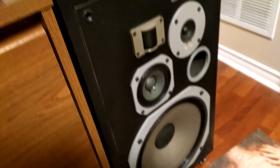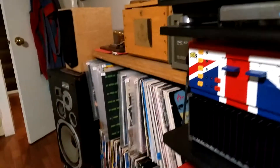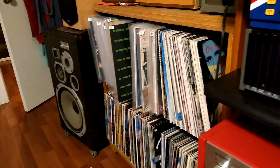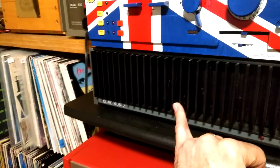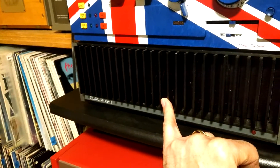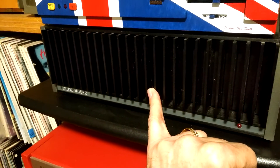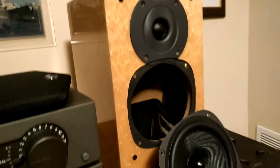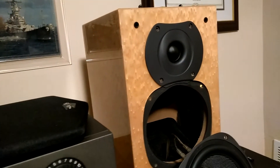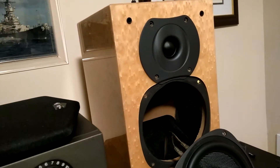What I should have mentioned earlier is that I've hooked up two other sets of speakers — a pair of HPM-100s and in the back room I have some Celestion Ditton 15s. Both the HPMs and the Dittons, when hooked up to my Quad 405-2, sound absolutely perfect when hooked up the standard way, which is black-to-black and red-to-red on left and right channels. So when I plug the Quad L12 IIs in, I have to invert one set of speaker wires to get them to phase correctly.